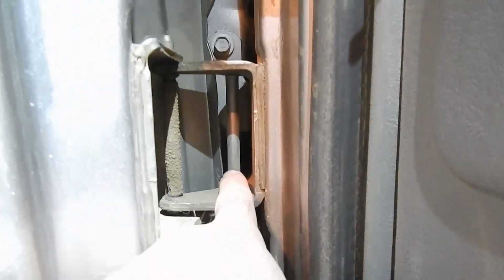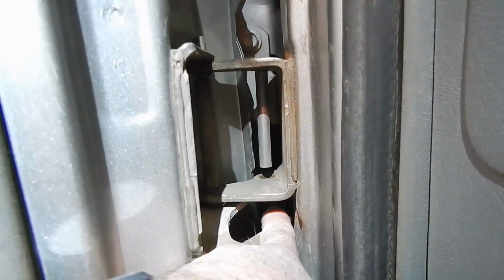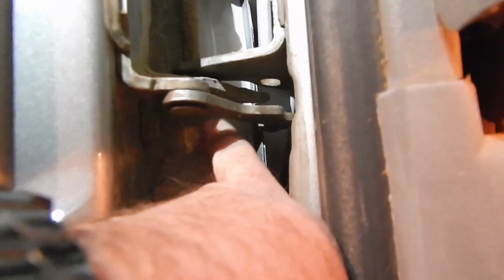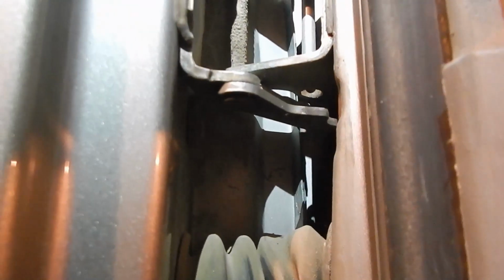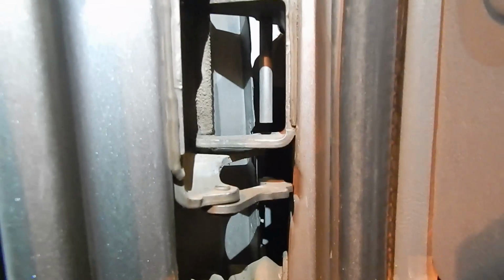Right here, you can see this one's got some missing. There should be a roller down on this side, and then your spring should fit in. I know it's hard to see, everybody, but there should be a spring in here, and we'll see what we want to do. We may try to get that fixed up. We're definitely going to have to put in pins and bushings. The roller pin is a little more of a job,